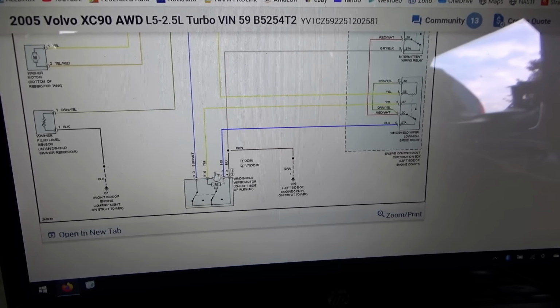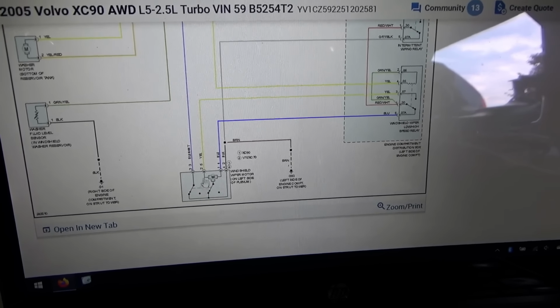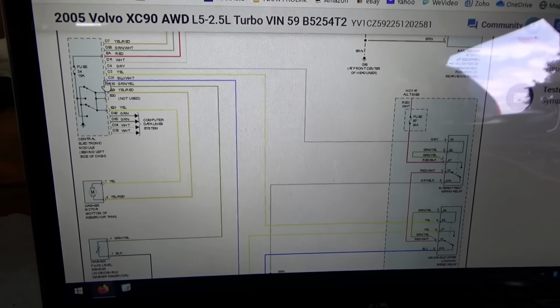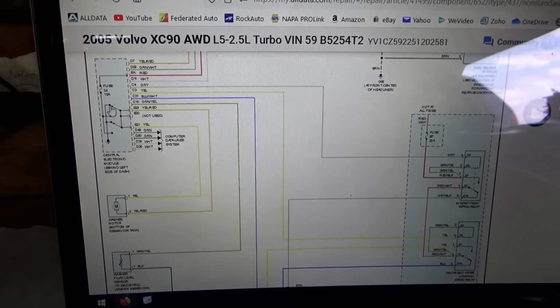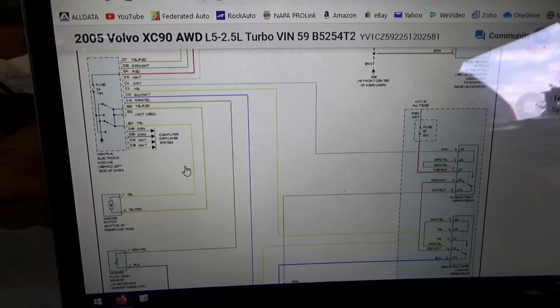Now there's a third wire from the wiper motor. Blue and white, that is the park sense. And it comes here, C31 to the CEM. So the CEM needs to know when the wipers are parked, and then we can energize the relays and activate the wipers. Okay?